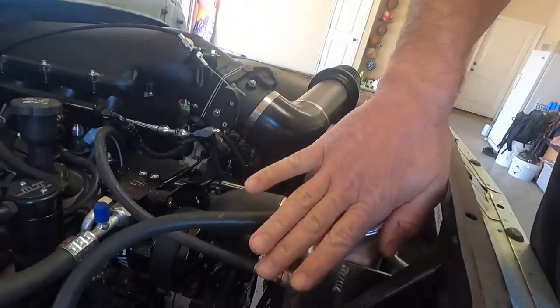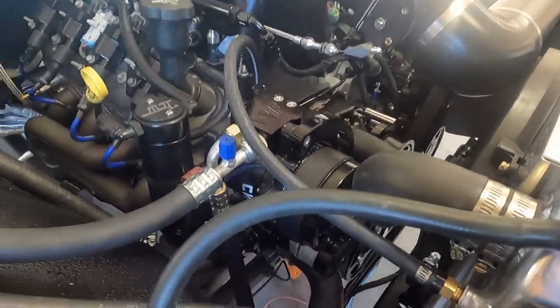Got that coolant to close to 200 there. Decided to shut it down because it will actually heat up when it sits here and soaks a little. I don't want to overdo it this first test, but the only thing I could see that was leaking was the little steam vent line going into the radiator. That thing was pretty tight, so not sure, maybe just get some tape and wrap that up. Yeah, full temp, I didn't see leaks.